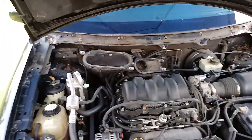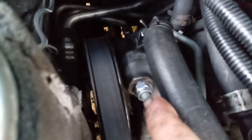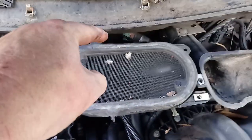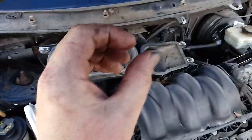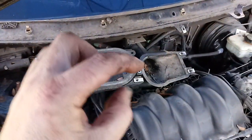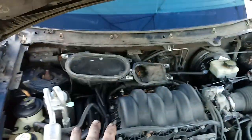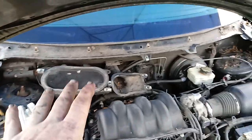Here's a tip for guys doing this job on the Windstar — it's not step-by-step but it's easy. You're going to get an 18 millimeter wrench; if you have a crow's foot it'll make your life a little bit easier because then you don't have to remove the big hose. Go under the vehicle on the passenger side — there's a bracket with just one 8 millimeter bolt holding the hose down. Pop off that bolt, then get the car back down.